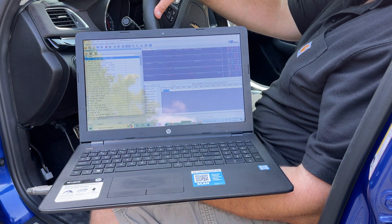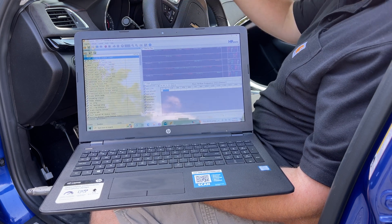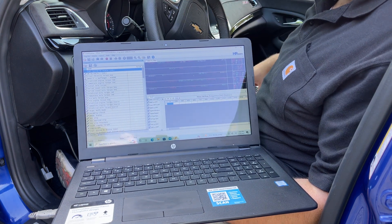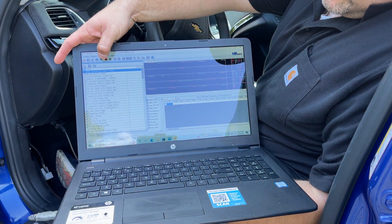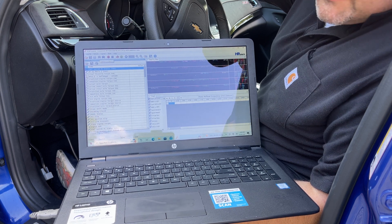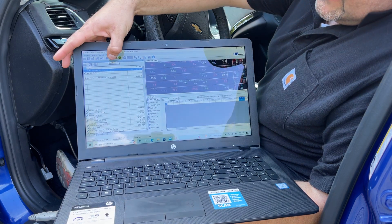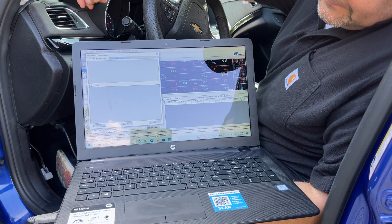What you're looking at is a standard screen on HP Tuners for the scanner. What I'm going to do is get the car fired up. What you're generally looking for — we're going to connect to the vehicle. This is assuming you guys know how to hook up HP Tuners, or you could even do this with a scan tool. I just happen to have HP Tuners here. I'm going to run a quick scan, look at the car, make sure everything's going well, and then right here there is this engine symbol — click on that, read your DTCs.